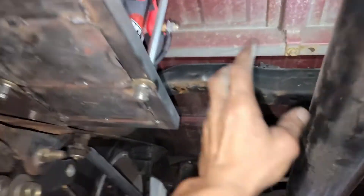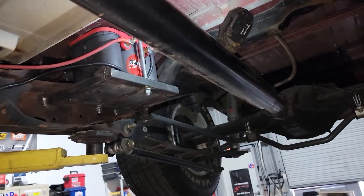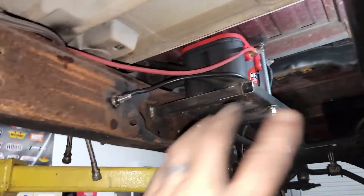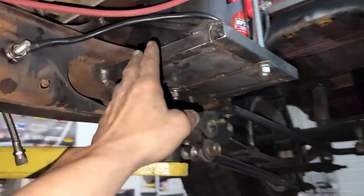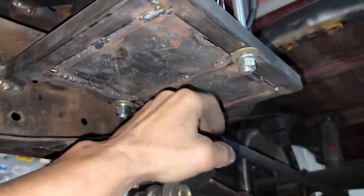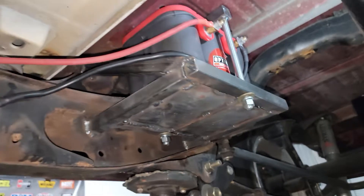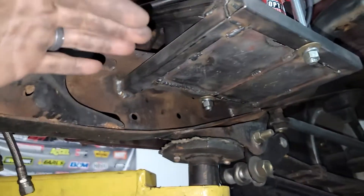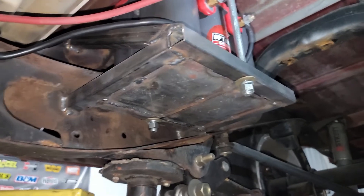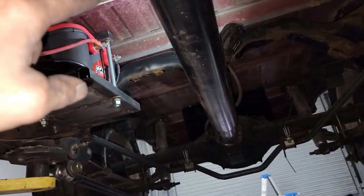I got the idea from the 35 that was here — its battery on the Factory Five is up in here and it's one of those little lithium-ion batteries, and it worked pretty good. So I had the idea to make a tray, set the battery in the tray, and go from there. I made this tray, put a bottom on it with quarter-inch round bars to support the tin from falling. I held it in place, made sure the battery would fit in and out fairly easily — it'll slide down right in front of the mount in between the driveshaft, or you can get it up and slide it back.